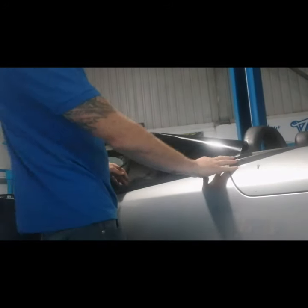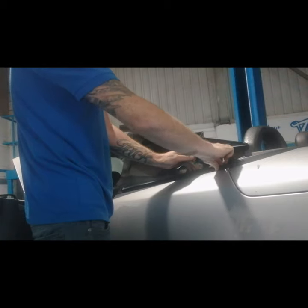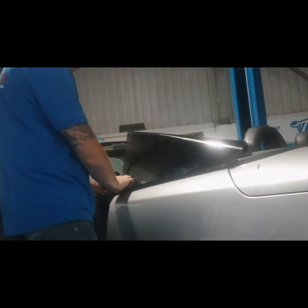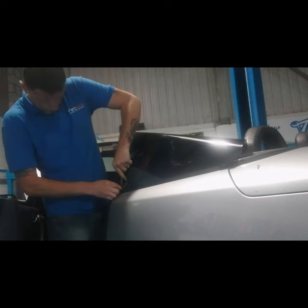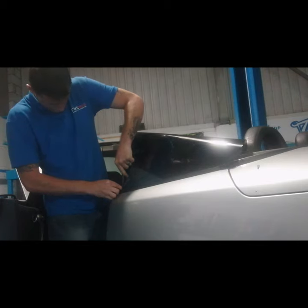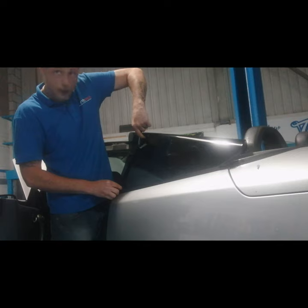Let's pretend this rubber is a funny shape — which it isn't. You're going to put the tint over it, find that edge, stick your knife right in and create the shape. In this case it was a complete waste of time because it was already straight. The first thing we're going to do after lining that up is cut our straight edge by digging our knife against the bar. Make sure the knife can't go anywhere, give it a quick wiggle, check it's in the correct position, and just slide it straight up.